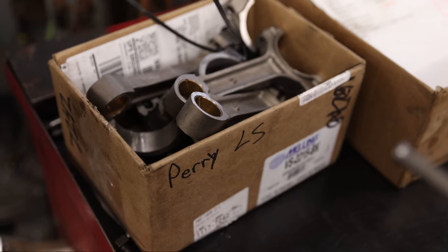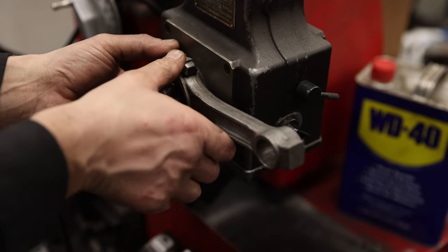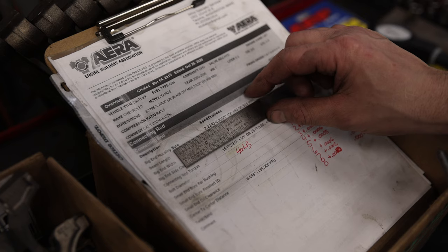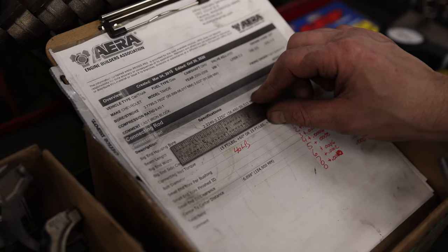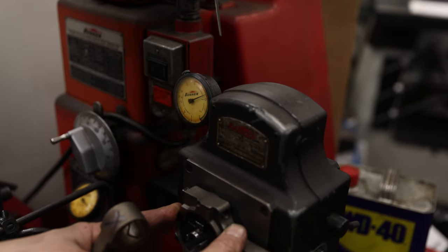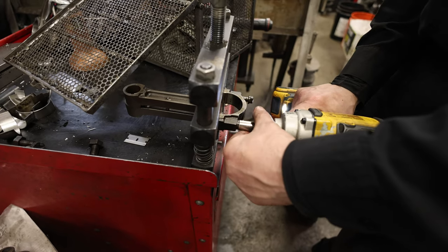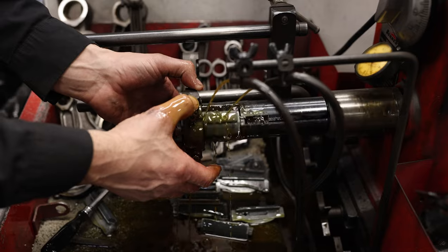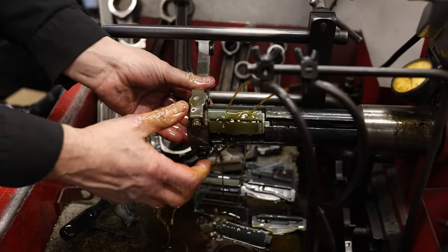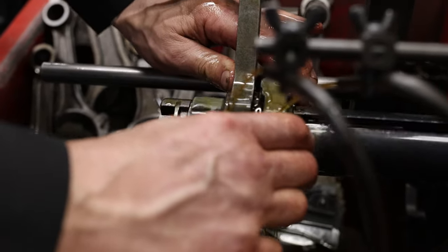For those of you already subscribed to the channel, you'll remember that in a previous engine building episode we cut short due to an issue with the connecting rods that came with the motor. The ovality of the inner bores were beyond specification. This issue not only kept us from finishing up the rods, but it prolonged other things like balancing the crankshaft. Now yes, I could have ran with those rods, but we've gone this far already and it seemed very pointless to skip such a small step. This also gave me an opportunity to go ahead and make a slight upgrade to Gen 4 LS rods versus the Gen 3 that I had previously gotten.